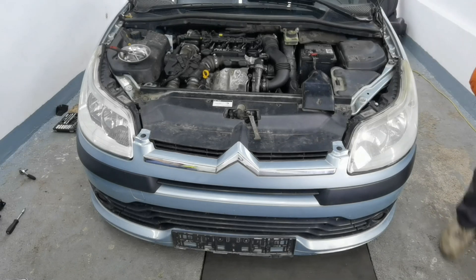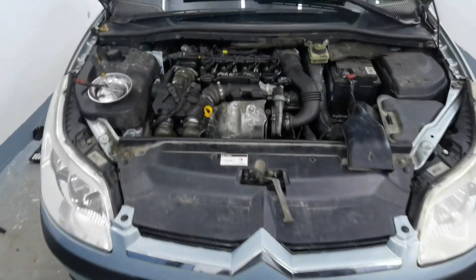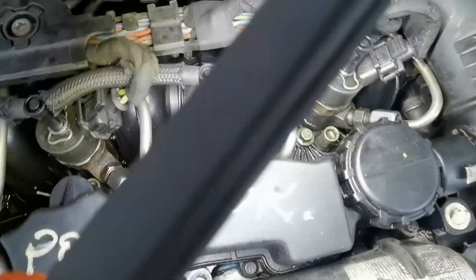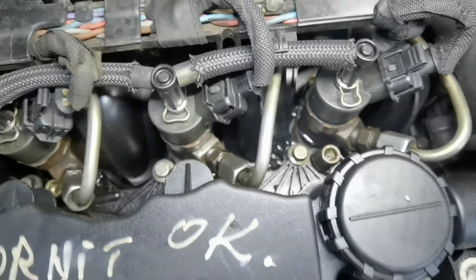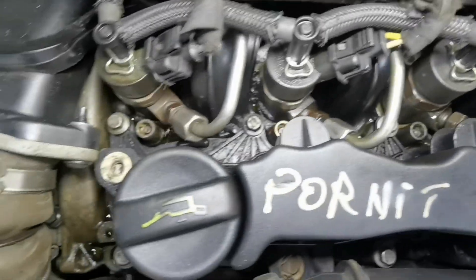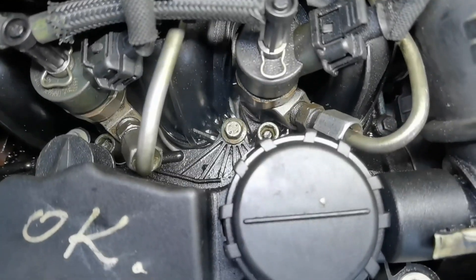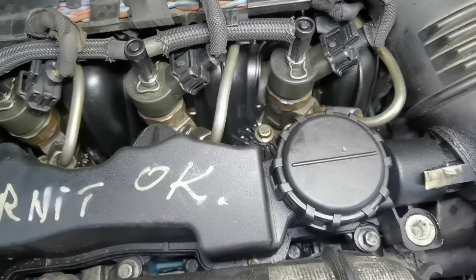As you can see, after I start the engine, if you look close onto injector number 1 and 2, you'll see a lot of vapors, a lot of gas around the injectors which is coming out from the engine. If you also have a lot of fuel around the injectors and you see that the vapors, the fumes and the pressure is coming out from the engine in the area where your injectors are installed, this means that you have bad o-rings or washers.